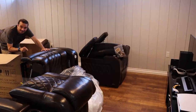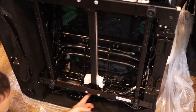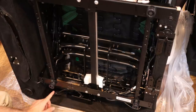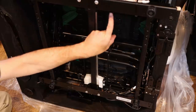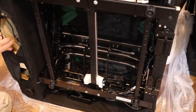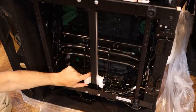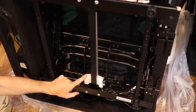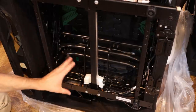Here's the cool part. Right over here we have the power cord that we plug into the wall. This cord goes down to this controller for the whole unit. From here we have wires that go up to this motor right here. Then we also have this wire that goes up into the armrest, up to the top where the controller for the unit is. This white piece is a slider controlled by this motor — this is what pushes the footrest out when you press the button. There are also two other cables that go up to the backrest and the headrest.